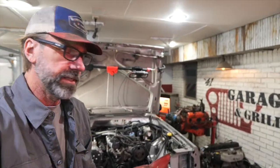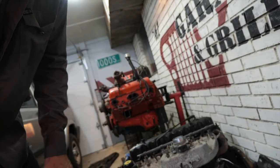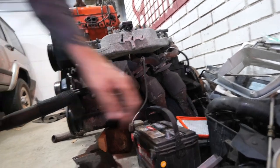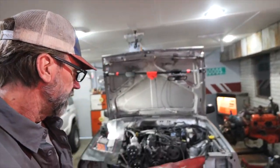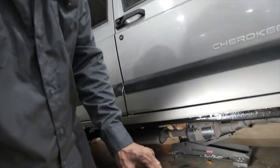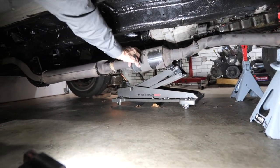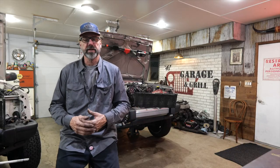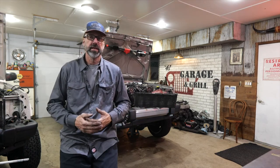Starting off another day. I did a little searching on the internet and I want to show you what I found. Here's the motor that was out of the gray Jeep originally. I have the O2 sensors and catalytic converters right there, then two more O2 sensors below that. What I found out is that is considered the California emissions setup. Whereas this is the exhaust out of the white Jeep that I put in the gray Jeep. You can see the catalytic converter, the rear O2 sensor, and then the other one's up towards the front closer to the exhaust manifold. That's the standard EPA emission setup. One's a California emission system, one is a standard EPA emission system.